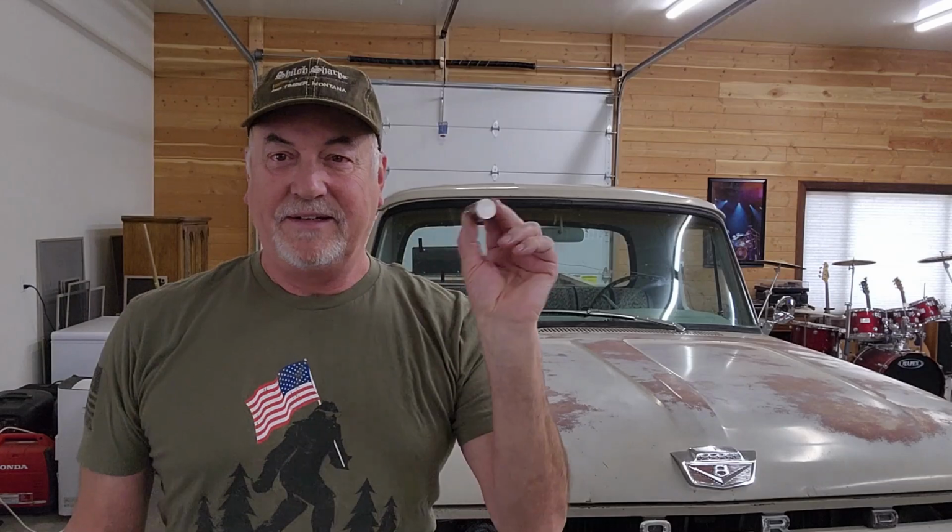A lot of you guys know this already, this is a flat tappet hydraulic valve lifter. It rides down on the cam and the bumpy stick and goes up and down 25 times every second and moves the push rod, rocker arm, valve. Okay. Now, these are kind of interesting little developments.